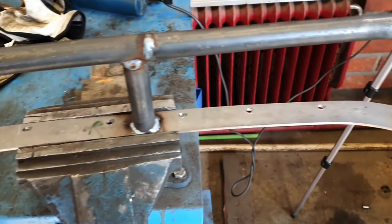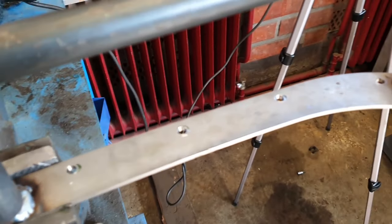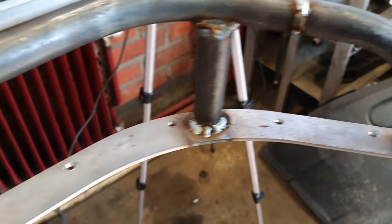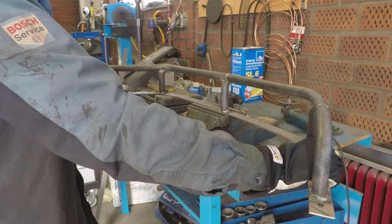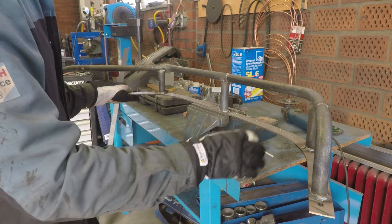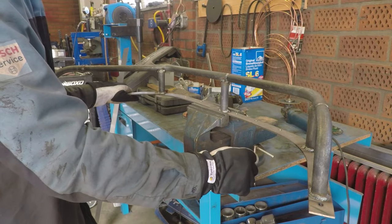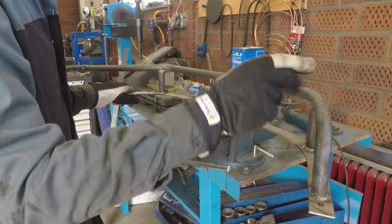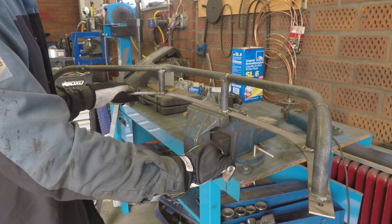This is all burnt in place, nice and solid. Some of the welds turned out great, others are not so good, but it's really solid overall. When we put the 2mm plate over, it's going to help reinforce it more. There's no question it warped during welding — with this kind of shape you have to take it real slow, or wrap it in a big blanket after welding while it's still hot so it cools down slowly; that generally helps with warpage. The nice thing is we'll be bolting it to the side of the vehicle, which is almost 0.9mm sheet metal, so that will conform to this shape and everything will generally look okay. I'm going to grind down the welds on the outside of the pipe and at the top where we have to put the sheet metal.